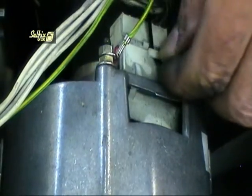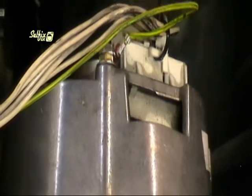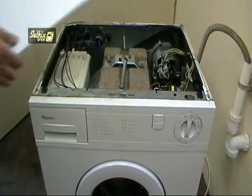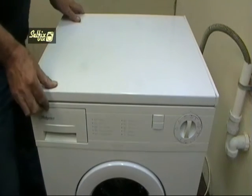The joints on these wires get a lot of movement during a normal wash cycle, so if you have a cable tie it is to your advantage to tie them to the harness, or one or more of the wires could break and in that case you may have a job locating the fault. When you are happy that everything is tied down and tightened, replace the top, do up the screws and the machine is ready to be tested.